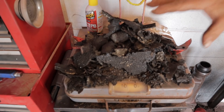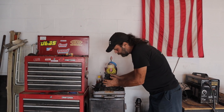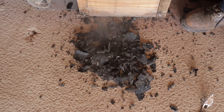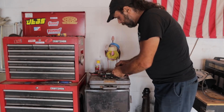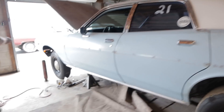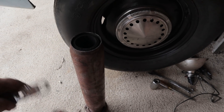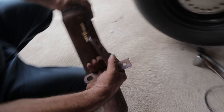I took seven more pounds out of this car without upsetting its integrity or taking away from its purpose. All of this undercoating here — which adds up to a couple of pounds — came from the top of the front fender. When we went through the car the first time it was rushed and wasn't exactly neat and precise, so I went through yesterday and got all of that. These little slivers, nuts, bolts, and brackets were mounted on the mufflers, along with a little extra piece of muffler. I had originally trimmed these down when they were under the car but didn't get them perfect — they were off on a slash. So I cut the muffler clean and got rid of these brackets that were attached to the mufflers. They're gone now.